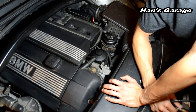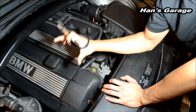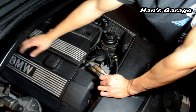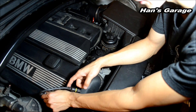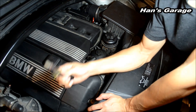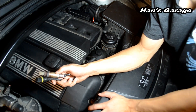So what does it mean if the system is running too lean? There are four oxygen sensors in total. There are two catalytic converters for this engine — one for bank one, cylinders one, two, three, and a second catalytic converter for bank two, cylinders four, five, six. Each catalytic converter has two oxygen sensors — one right before and one right after the catalytic converter. If the system is running too lean, it means the oxygen sensor is detecting too much oxygen and less fuel.